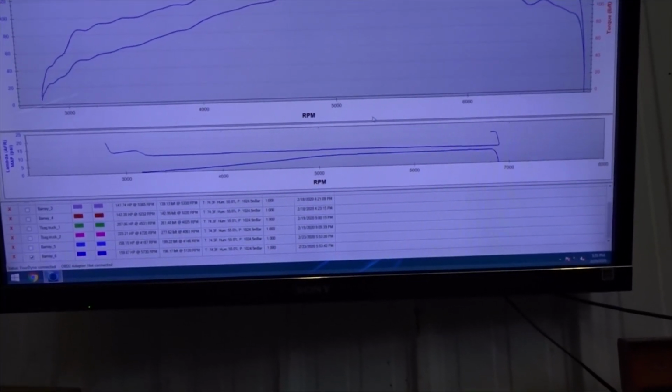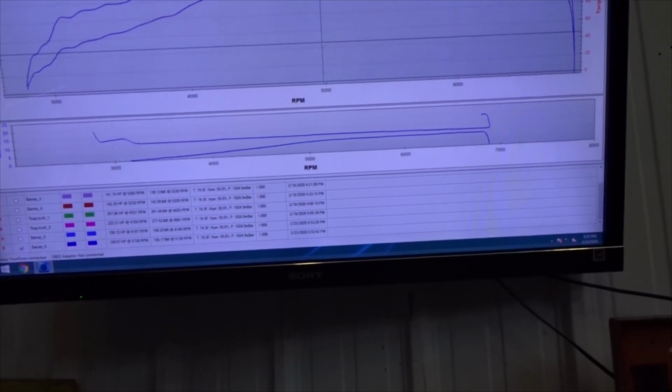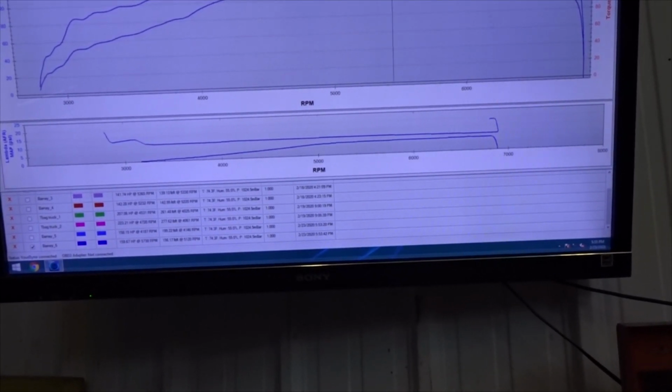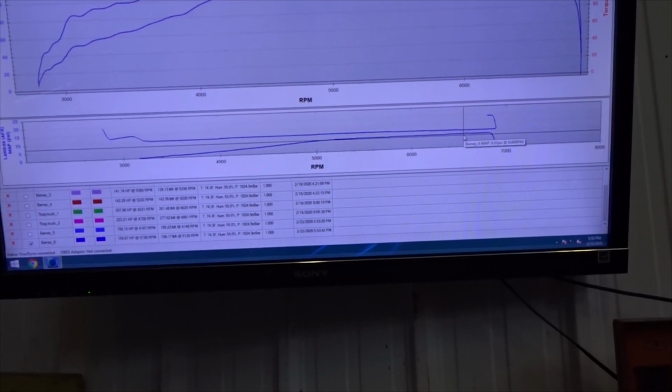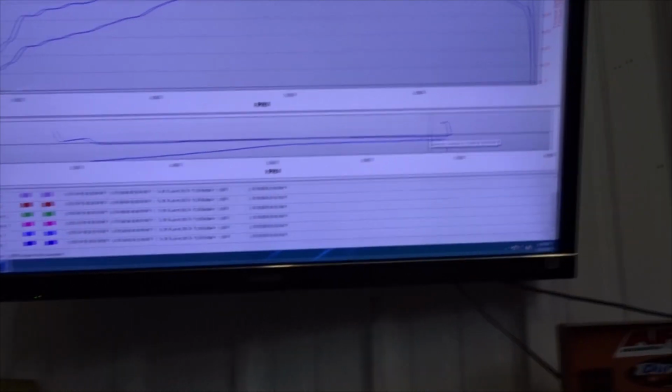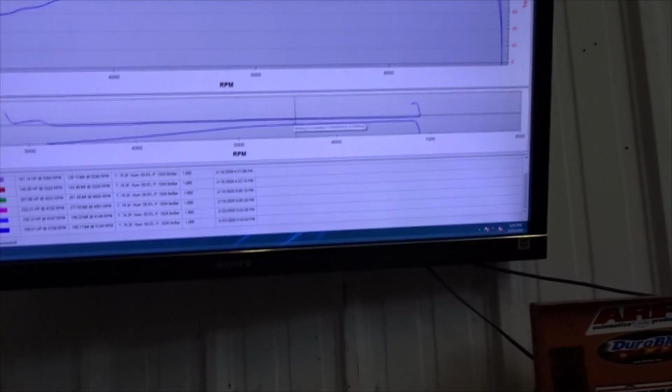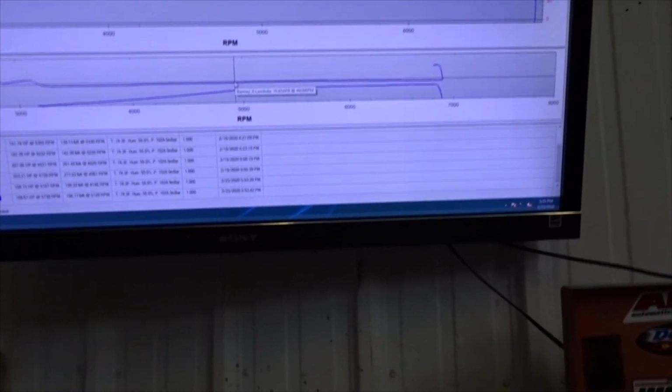Hit it like 6 times the VTEC, get it quick. Well, at least not getting cut, so. Right. How much boost? Okay, so you see where VTEC's gotta go? Yeah. Eight pounds. Seems a little low on air fuel. Yeah, a little rich there, Pop. Keep it conservative. Right.